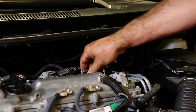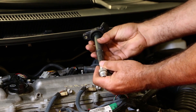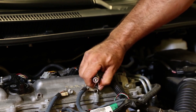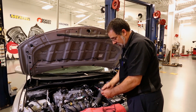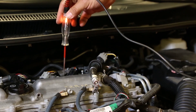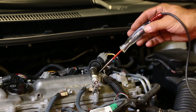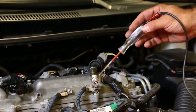We'll pull our coil out and put our test spark plug to a good ground. With the ignition turned on, we've got a test light here hooked up to B+. We're going to use this reduced voltage to act like the trigger from the computer on that circuit, and if the coil's in good condition, it should be able to jump the 25,000-volt gap established in this test plug.